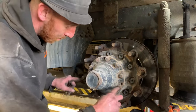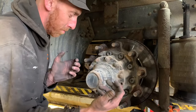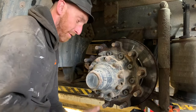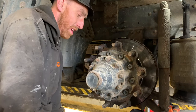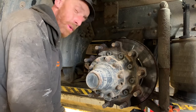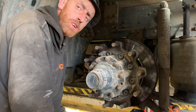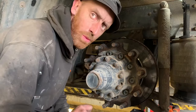You've got 3 draw bolts here, look, but the tapered collets, so you can't just draw them off. They don't normally just come off. If they come off by hitting it, you're very lucky. Because I don't think I can recall ever having one that just pops the collets out straight away. But then again, I do work on old stuff, don't I? Perhaps the new ones, they don't do it, but still. So I'll show you how much I struggle with these collets.